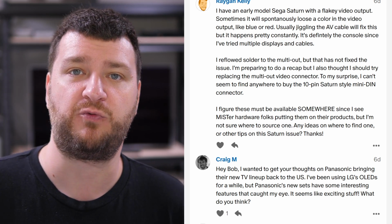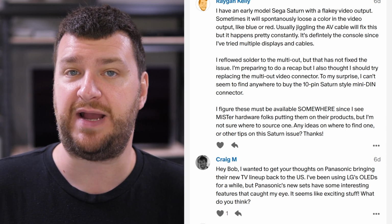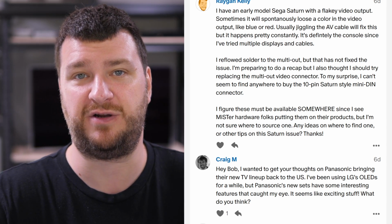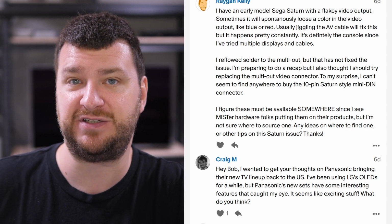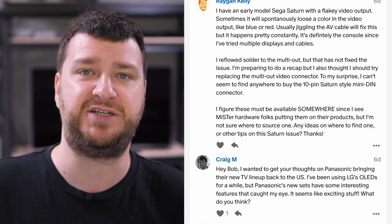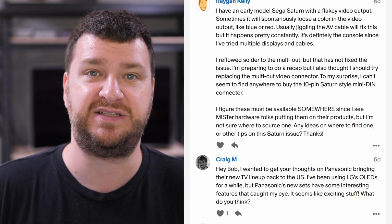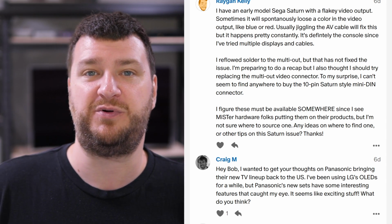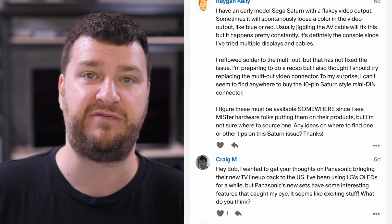But there is one thing that really stood out from that video: the speakers on there supposedly are actually very good. And basically all flat panel speakers are terrible compared to most CRTs because there's just not physical space to do it. And that's not like a CRT is better thing. It's just that when you have a lot of depth and a lot of extra room, you could put a normal sized speaker. But when you have a flat TV that's supposed to be ultra thin, you have to put tiny little speakers that just can't reproduce the same sound and move the same amount of air.